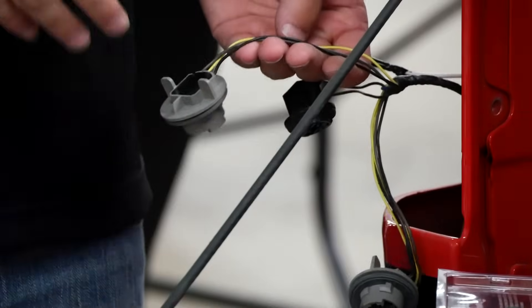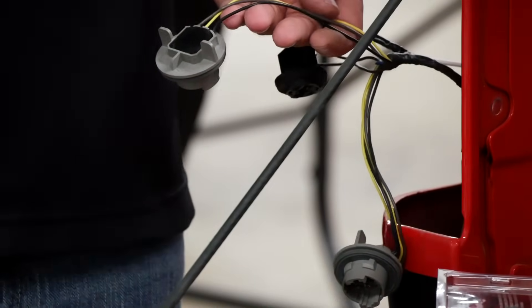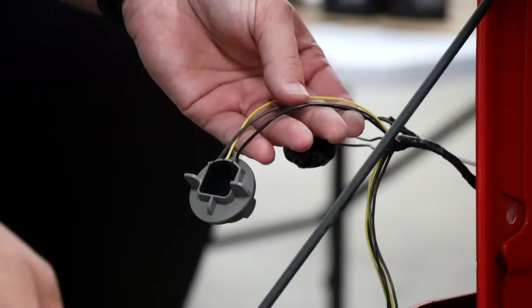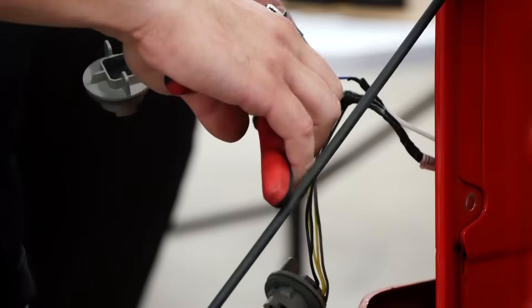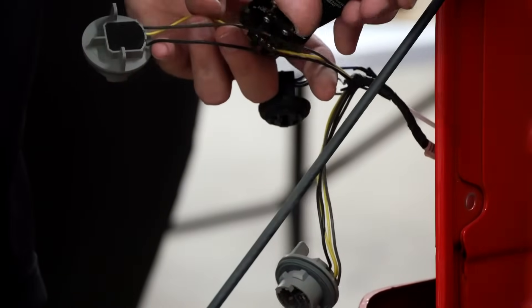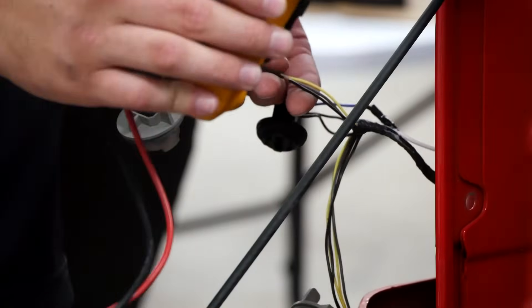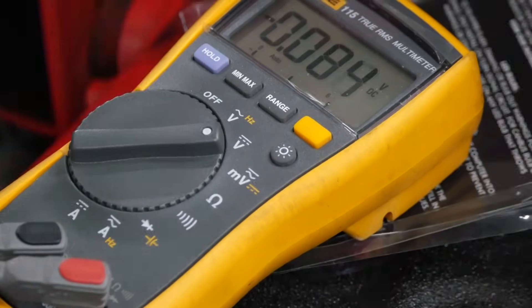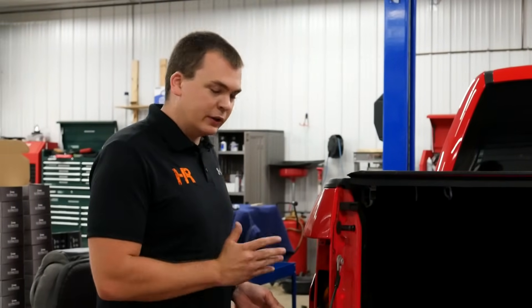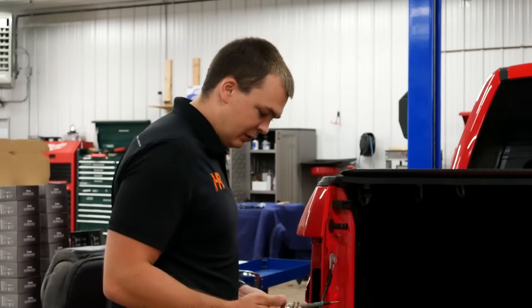I'm going to show you how it all works. Step one: you want to turn your turn signal on. We need to test and make sure that we're on the right wires, and we can't do that if the turn signal's not on. I've got three wires here, and the way I like to do it is just strip the outside one back, the middle one back, and this one back. These automatic wire strippers are a lifesaver for projects like this — you can get them at any parts store. If you're going to use a multimeter, set it to volts DC — it's a solid line with a dotted line below it. Although I have a really strong guess as to which wires are my turn signal wires, I'm going to pretend that I don't, and here's exactly how I would figure out which one's which.